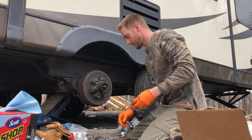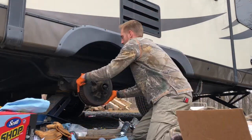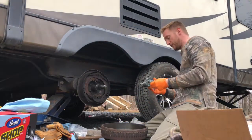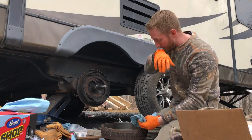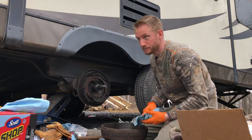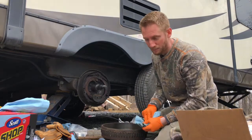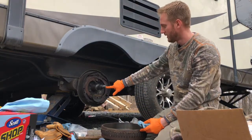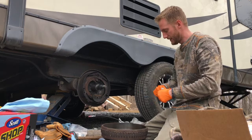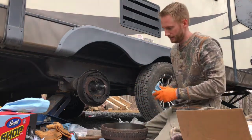The hub is loose so now I'm gonna lay something here and sit it up. Two of my brakes were good, two of them were bad — as far as there's grease all over my magnet and the inside of this wheel. The inside seal blew, and that's probably because someone tried to fill it using this easy-fill nozzle. If you blow the bearing out from too much pressure, we're not gonna do that — we're gonna fix that.